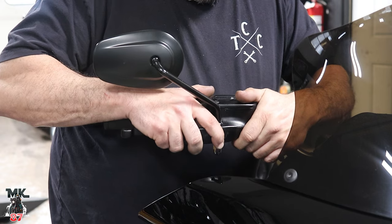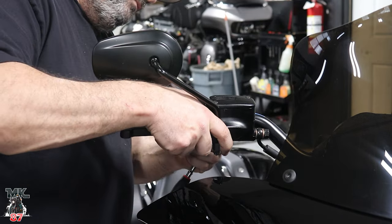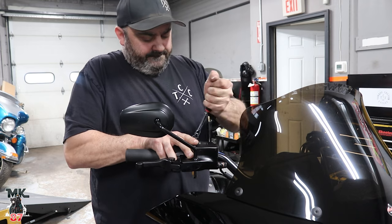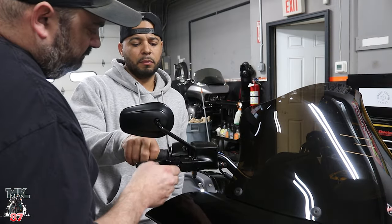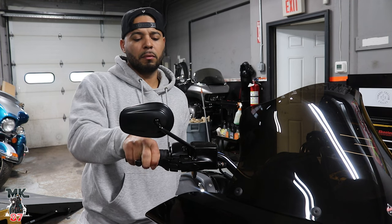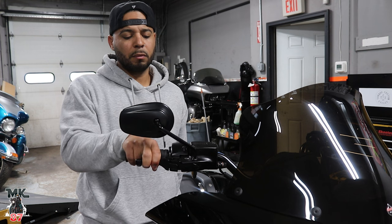What I did was put a little piece of tape on the handlebar so I knew where it was lined up before — smart. Tighten these down because they weren't before. When the lever is pulled in more you get more pull — it makes it more sensitive.